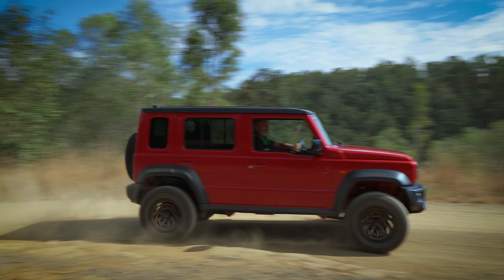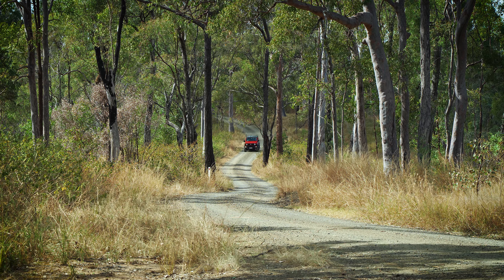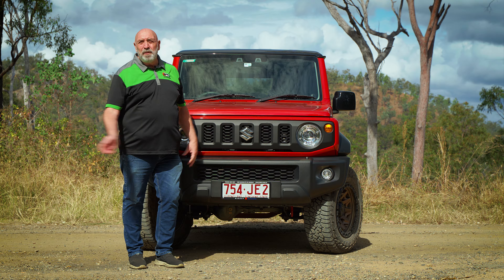I can't wait to take this thing for a drive with all the enhancements. We've just left the workshop, we're on our little test track and we're test driving it. We drove it before in standard trim with the same tyres and everything on it, so we now get a really good indication of how good the upgrade is. With the standard suspension on some of the corrugations it was doing this little skip thing, but on the same track, same tyres and same tyre pressure, with the upgraded shocks and coils it's far more controlled and just soaks up those corrugations. It's absolutely perfect.